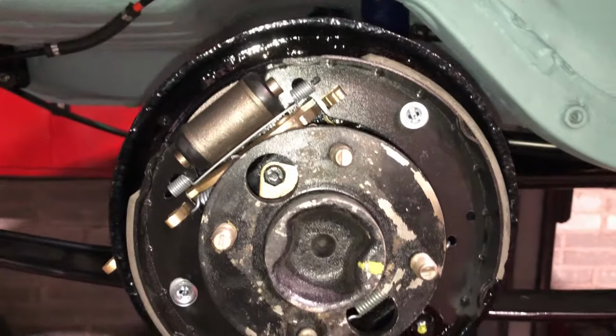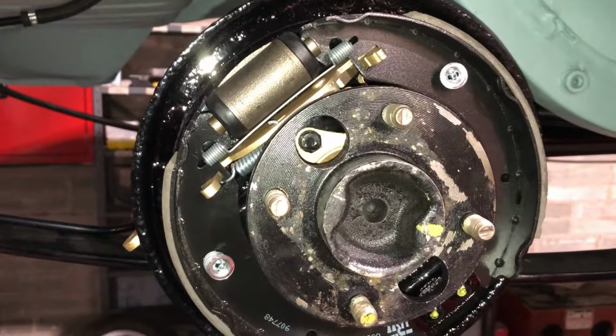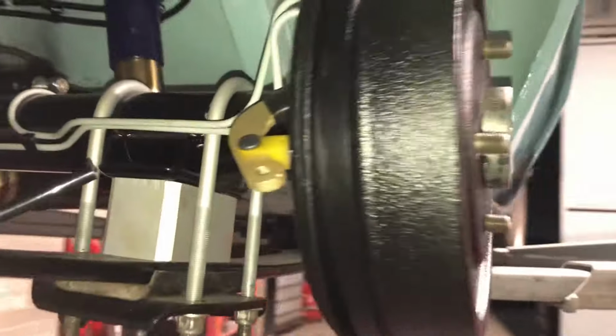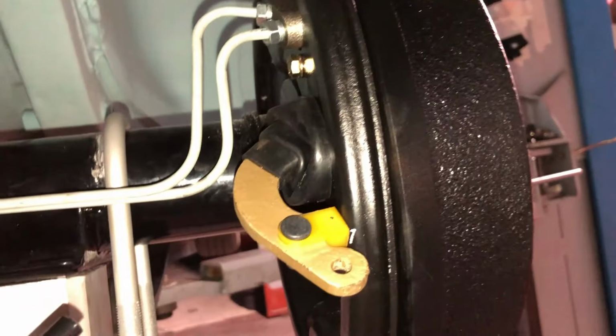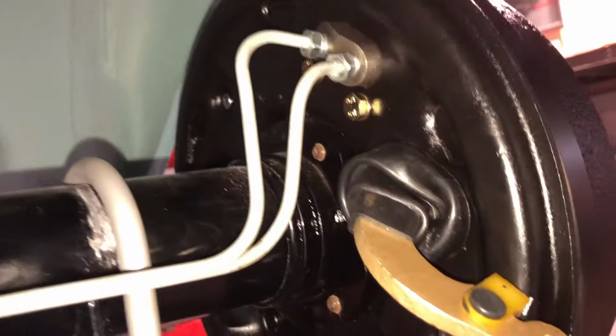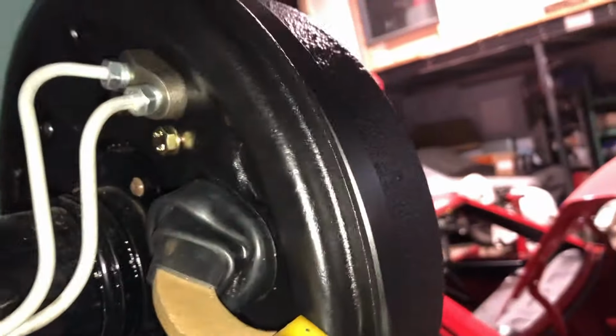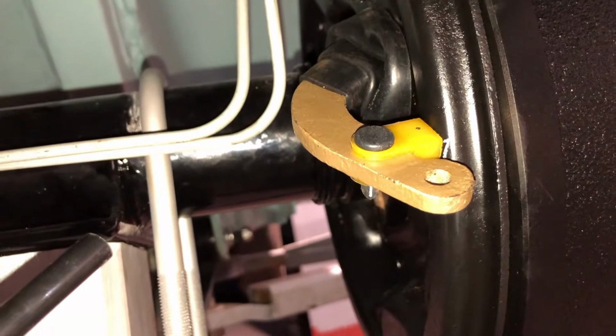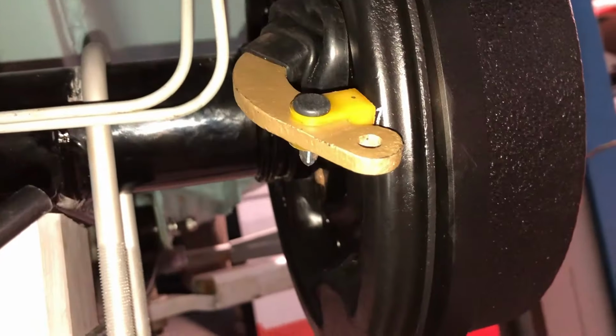Get the 2.8 back plate off. Same again. And that's the driver's side completed too. Gaiter on the back, all brake lines are in, new hardware, locking washers, gaiters, new, well it's not new, that's an original one cleaned up. Brake stop. Well done.